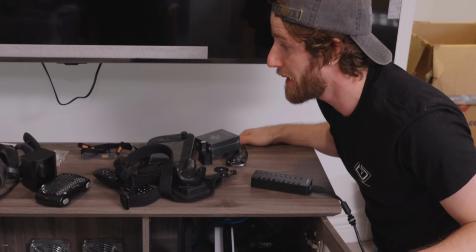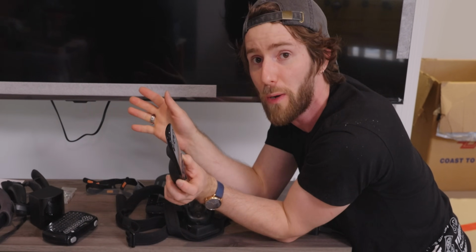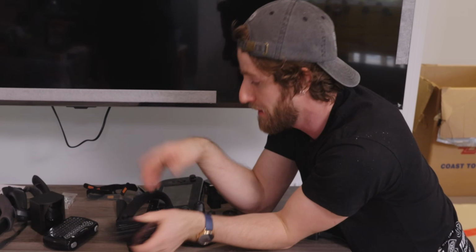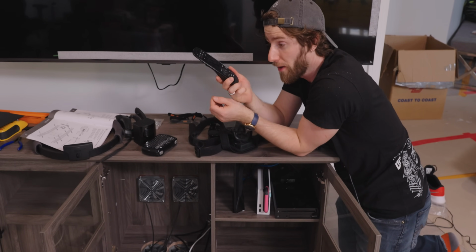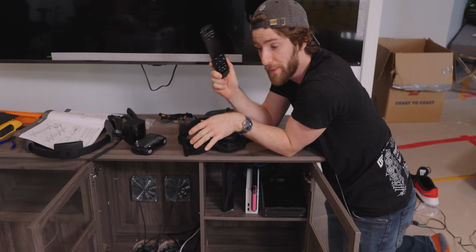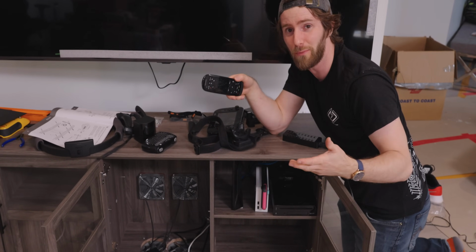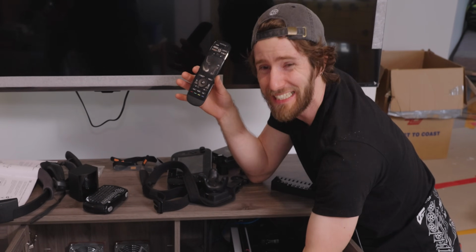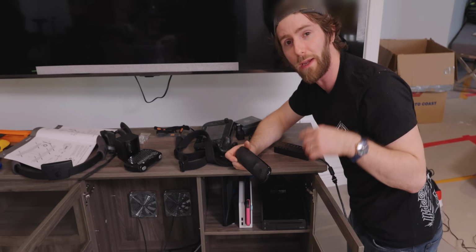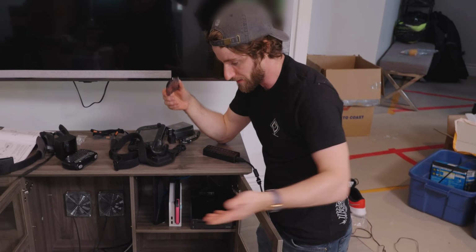Perfect score? All right. I'm hoping to just transplant my old Harmony remote setup here and just pick up right where I left off. So it's one button to select all the right inputs and outputs and, you know, power on devices, power off devices. If not, I'll have to find another solution. There are other universal remotes that exist now that Logitech shuttered the Harmony division, or I could just rely on CEC. But the issue is that with a PC, relying on CEC, which is where you power on one device and it tells the associated devices to power on, is that PCs are just not really designed with that in mind. So what you need is one of these old Microsoft IR receivers, and then you can tell it to issue a sleep or wake command to the computer so that it won't just be sucking back 100 watts all the time. It's got a 3080 in there.